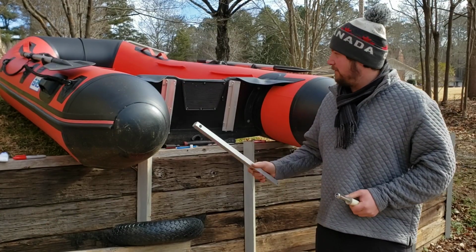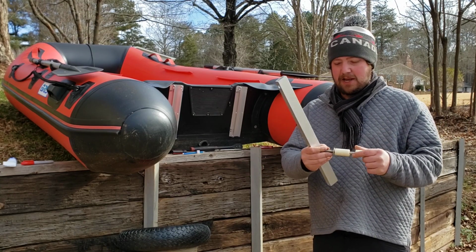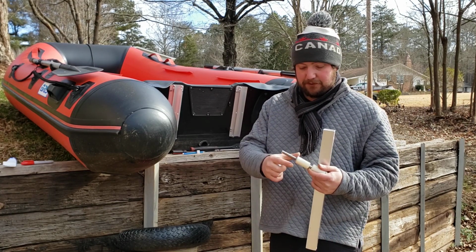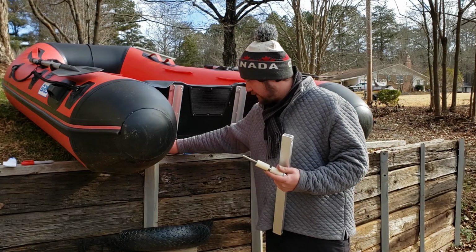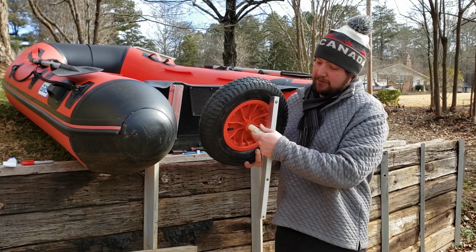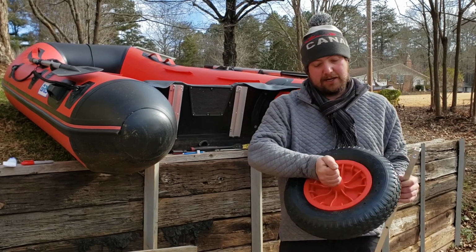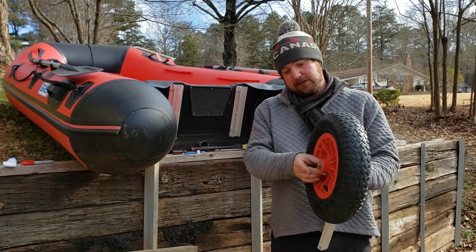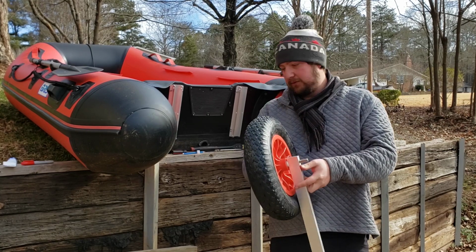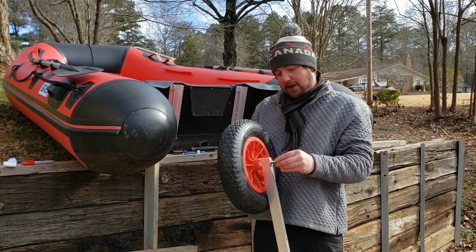All right, so our last step after you get your pieces mounted is you're going to take your arm, you're going to have bolts, it's got spacers, and your tire. With this one, you're going to take off your nut and your washer, set those to the side. And on these, I'm going to put the valve stem out so the bolt will go through on the valve stem side. And then that's what it looks like with it all the way through. Take your arm, slide it up on the bolt. And this is where you're going to replace the washer and the nut.